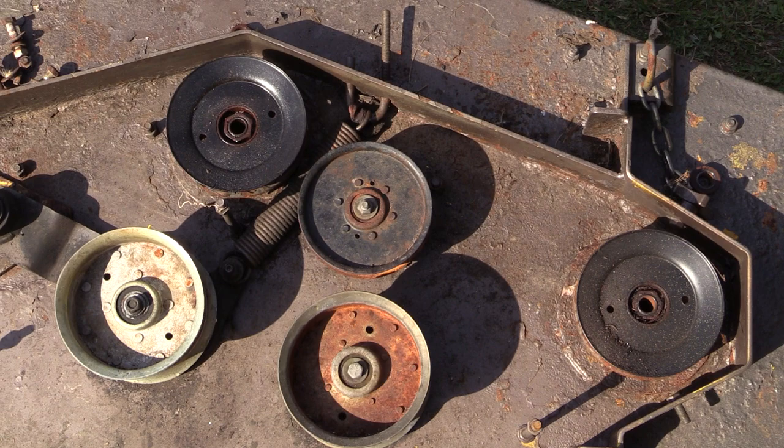You can see it pretty good on that one. They have the deck, and then they weld these rings on here — it's double strong. But what that does is it creates this gap between the deck and the hub — it's a channel. It holds water. Grass gets in there, stays in there. If you don't remember to blow it out, it will start to rust and decompose your deck. All three spindles had that happen. Some are much worse than the others — just horribly gouged in there. That is why I replaced the entire spindle assemblies.